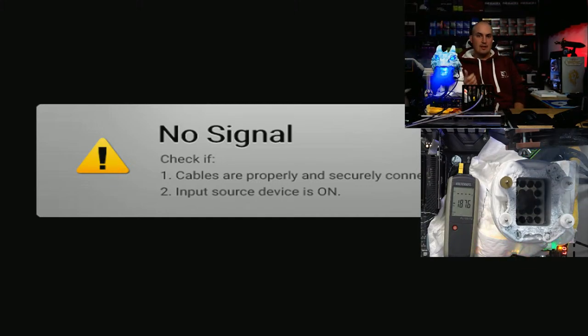Usually no, because I already ran these settings with the 5800X. And with the 5800X, I can do full pot at 1600 MHz for FCLK. I had no issue at all running full pot with that CPU. So this is a CPU issue. If I put my 5800X now, I load the profile, we go full pot, and we bench at 6 GHz. So it's not a board issue, it's a CPU issue.